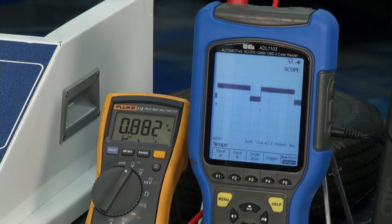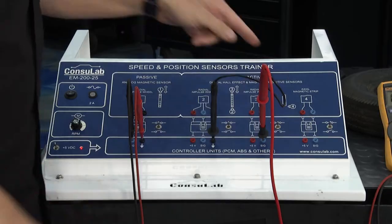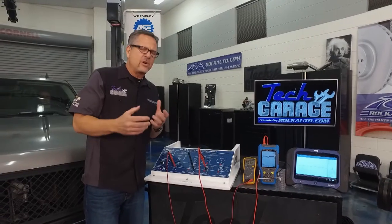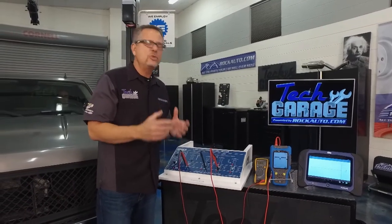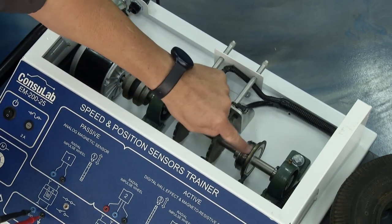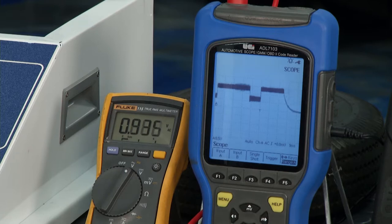Think about your digital cable signal — I dial it away, bam, gone; dial it back, it's there. Just like digital cable — you either have a picture or you don't. That's how cars work today. The last one is the axial strip sensor. A lot of autonomous cars have this because it's super precise. There's a bunch of magnetic fields on this little wheel. Look at the radial versus the axial — so many more signals, meaning it's a lot more precise.